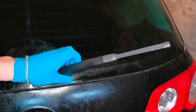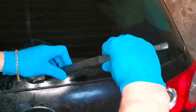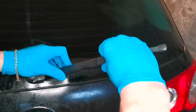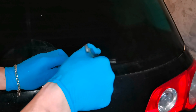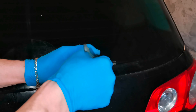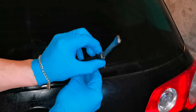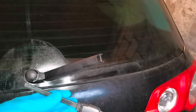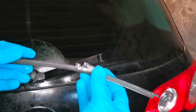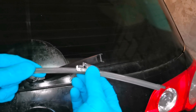From the back of my car, this is my wiper and in order to remove it I have to pull a little outside and also turn it like this. This bracket is sliding and after that you have to take it off like this. This is the bracket that you need to move in order to release it.